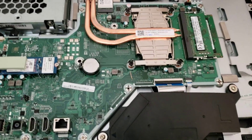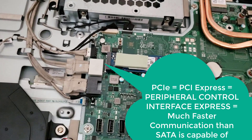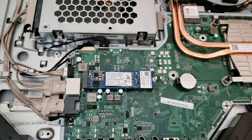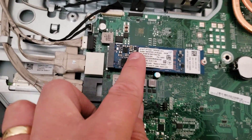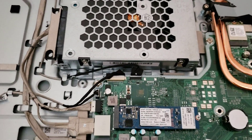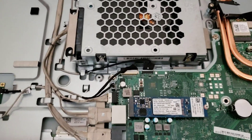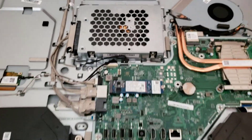With the heat shield off, you can see the memory — in my case an 8GB and a 4GB stick, oddly not 8 and 8. There's also a PCIe module here that acts as a very fast drive — faster than standard NVME used in most SSDs. Pull off the heatsink and you can see it's Intel Optane memory. It works in conjunction with the hard drive, the OS sees it as one disk, and it moves frequently used data — primarily the OS — to the Optane memory to dramatically speed things up.